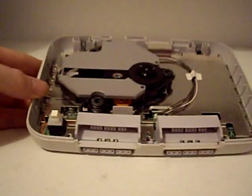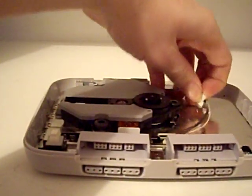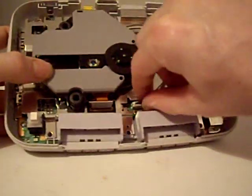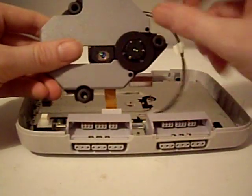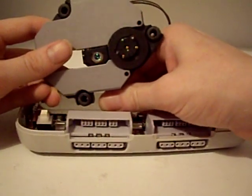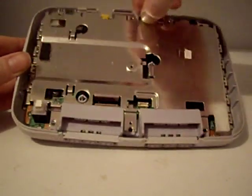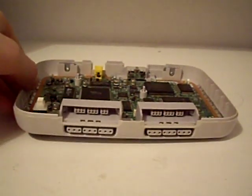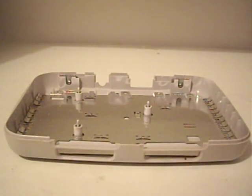Inside the unit there's a bit of tape here. We're just going to break that bit of tape like so, and pull out the ribbon cable here and pull out this ribbon cable. If we lift this unit like so, you can get a decent pull on it, drop it back and forth. Then put the laser unit somewhere safe. Now we're at the front, we just lift off this heat shield like so — this comes away. Again, put it somewhere safe. Then lift it from the front here and push up like that. Just lift it from the unit and put the base somewhere safe.